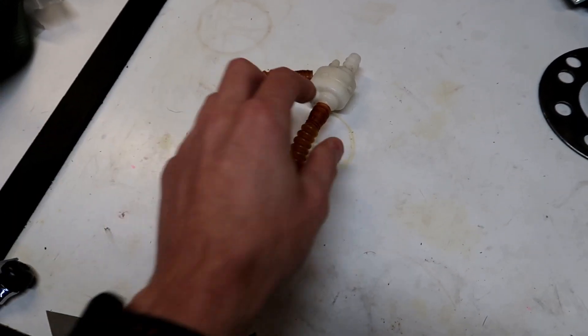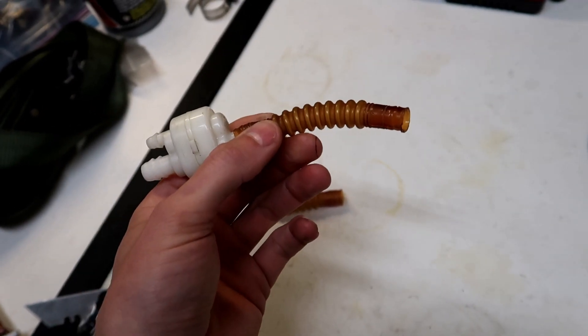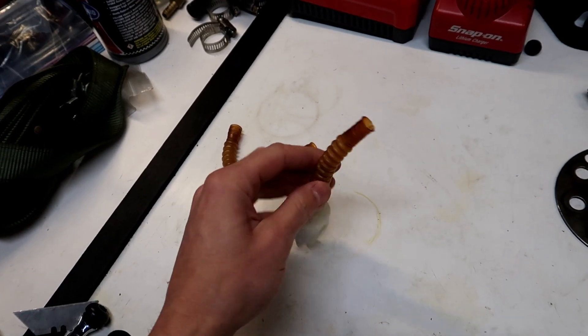So as you saw, we started working on the PPRV delete. I took it out - I didn't show you guys me actually taking it out because I had to go help a buddy and then go get some parts and I was in a hurry. What we did is on the pump - the two fuel pumps have these plastic lines that do a 180 and go down, and they Y into this plastic Y fitting, and then they go into the PPRV valve which we deleted. This is the PPRV valve - as simple as it gets. This side went up to the top of the hat where the line comes out going into the fuel filter, and this side was the line coming out of that Y. So the factory pumps sit one here and one here, the lines come up and both go into a Y that goes into this valve, which then goes into the fuel filter.